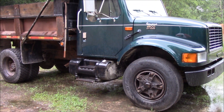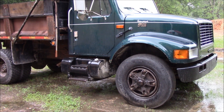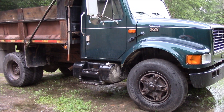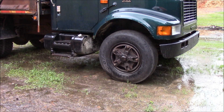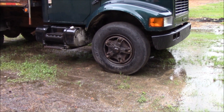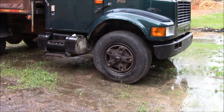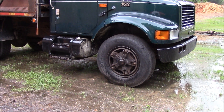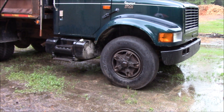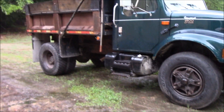I've got some things coming — some fenders, gonna get the hood repaired, some cleaning and shining it up a little bit. The paint wasn't really faded, it was just grimy from sitting. But those are the new front tires on the front. Truing them up — have any of you ever dealt with the Dayton front tire? It does not have split rims on it, so they've been updated. You have to tighten, loosen, tighten — back and forth, spin the wheel until you get it trued up. It's been fun.